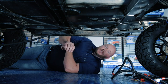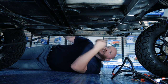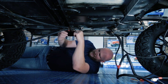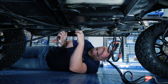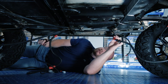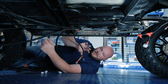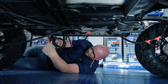The best way to run your harness is on the driver's side, starting with the tail light connections. You're going to feed it through the channels located in the frame and up into the battery well here. You're also going to bring your battery two pin connector with you. Stop here for your brake switch hookup and leave that hanging for now. We're going to secure the harness with zip ties later.